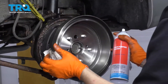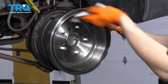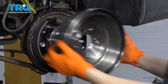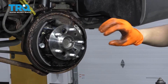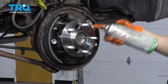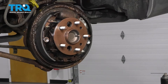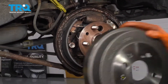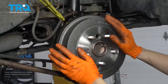Before the drum fully goes on, I'm going to clean the inside surface — it's coated in oil from the factory so it doesn't rust on the shelf, and you want to clean it off, otherwise your brakes are going to get oily. Before you put it on, if your hub is old and rusty, go ahead and use a wire brush or grinding disc to get all the rust off. You don't want any rust on here because that's going to make the drum sit crooked and you'll get a braking issue. Put on some anti-seize, trying not to get it too much on the brakes. When you put your drum on, make sure you line up the hole in the drum with the large hole on the hub — that's going to allow you to adjust the brake shoes through the drum without having to take it off.